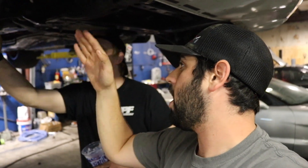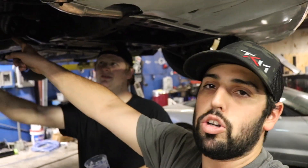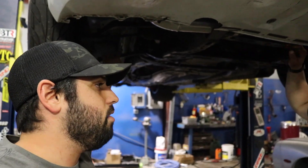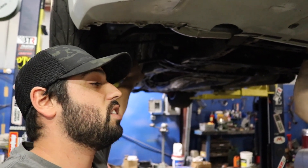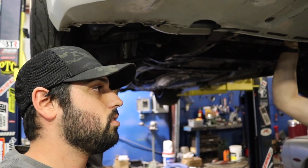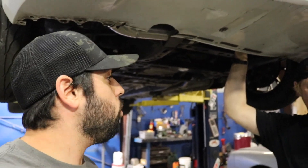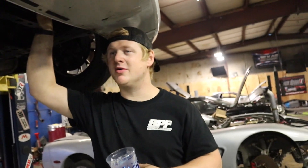This is way more efficient — this will net your time in the 60-foot, help your ET, get you going faster at the track. This is the 60-foot and 330 maker right here. Motion Raceworks travel limiters are $100 — it's literally the best $100 you will spend on your race car. We went 1.25 on a pretty soft tune-up. There's no reason anyone else out there shouldn't be going 1.25 if you've got 600-700 horsepower. If you're going 1.28 and you put these on there, you might go 1.26 because you're saving energy — you don't need that wasted energy. You're spending time going up instead of going forward.